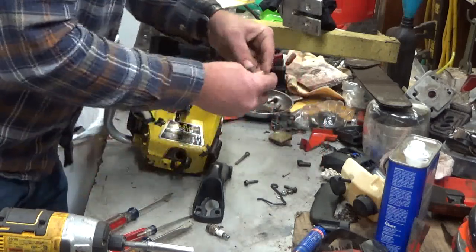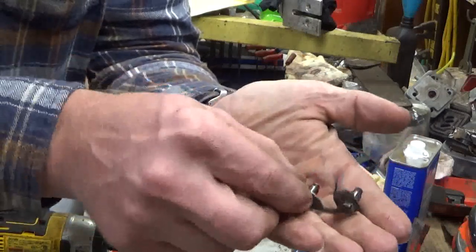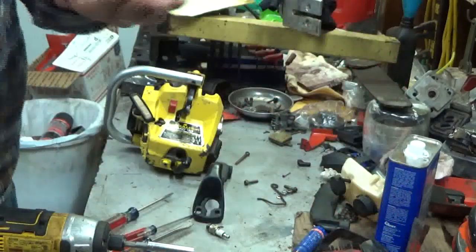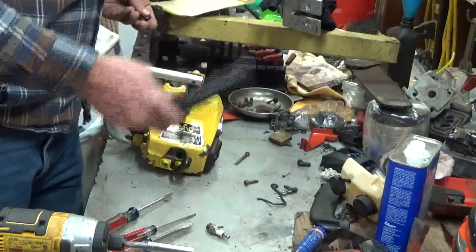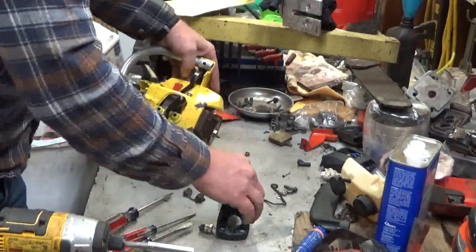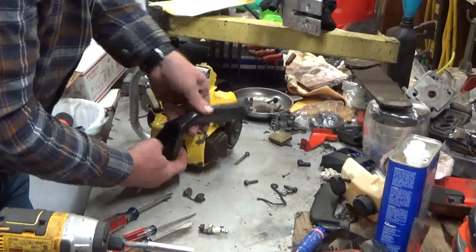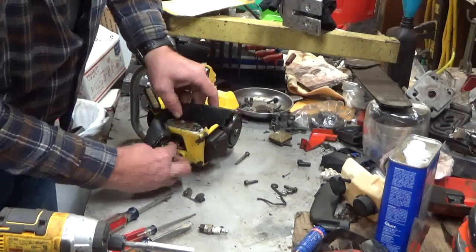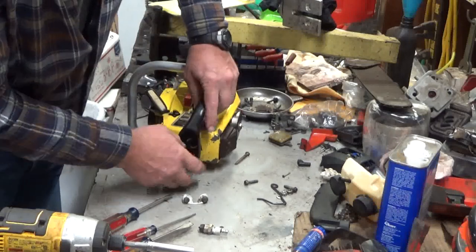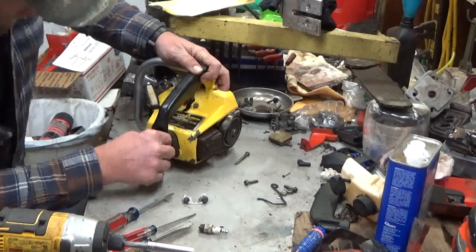The bottom has the strap here. And then you'll see that there's some spacers on these screws. Very important, if you tighten directly to this plastic, it is not going to last any time at all. So you want to get your spark plug wire through the hole in the handle and get it down into the notch. Yep. Set it into place.